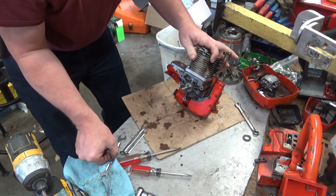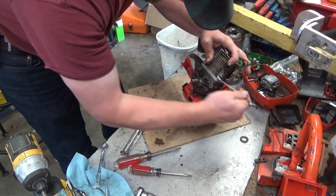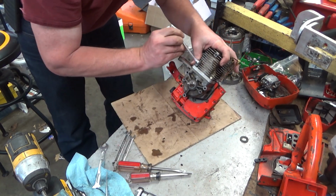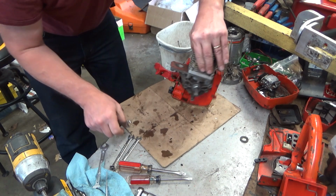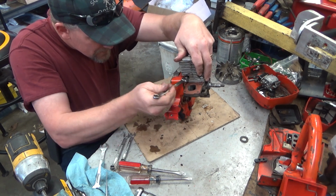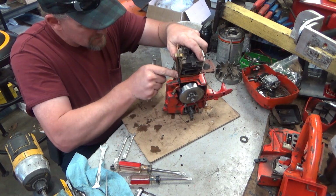Okay. Make sure everything is pulled down flat and not tighten anything too far until everyone is at the same spot. We know that we're not bound up on a cylinder stud, and if you guys could hear that little pop in the video, we obviously were somewhere. Not a lot, it was probably 32nd of an inch, but still. And our favorite spot right down here.